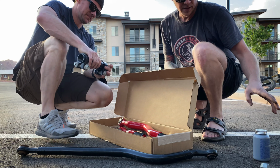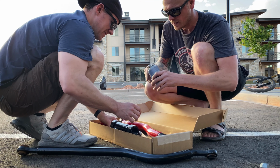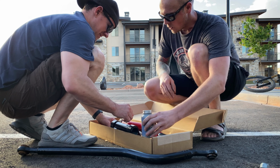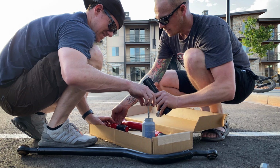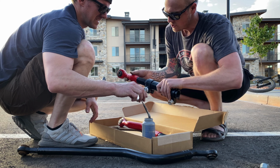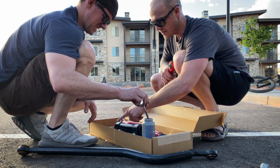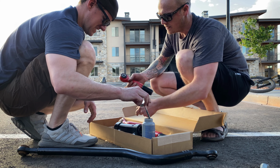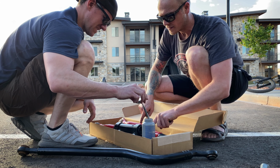I've done it a couple more times with you. So you're gonna anti-seize these just lightly. Yeah, and they're reverse threaded? Correct, so they're only gonna go in one side. Now, let me tell you the trick. Let's see if it's this side or the other side. See how they're on the collar here? There's nothing, and then there's two slits. That's gonna be the short end side. It's gonna go to the two slit side. Long end's gonna go to the one without a slit.